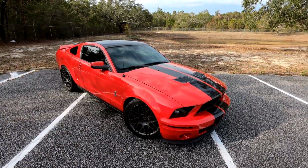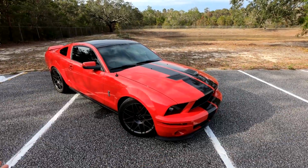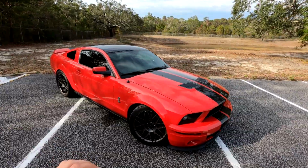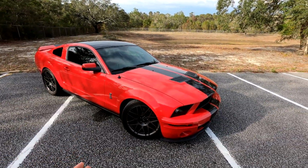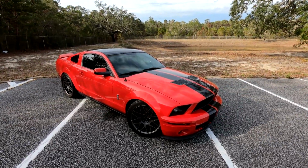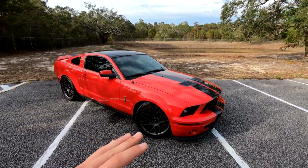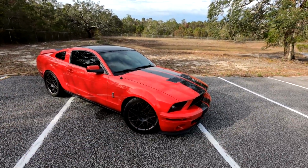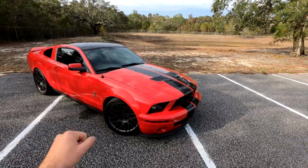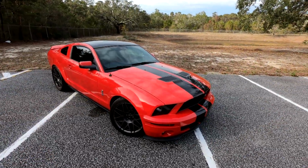The way that happens is when I push down on the gas, if you push all the way to the floor, you're obviously going WOT at that point. I have mine set to sense when the clutch pedal is down. There's a clutch safety switch, and it ties into that. The safety switch is so the car knows when the clutch is engaged and whether it'll allow you to start or not, things like that. Anytime it senses that the clutch is down with your foot all the way to the floor, it'll cut out spark. That lets you shift into the next gear without any kind of lockout, which is the biggest reason I think people go with these things.